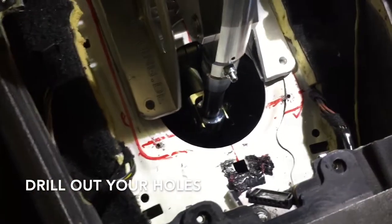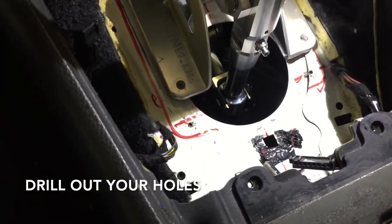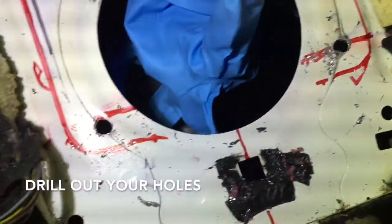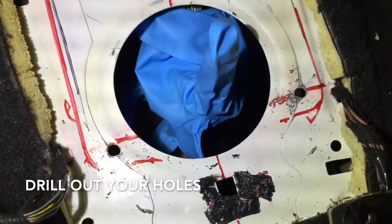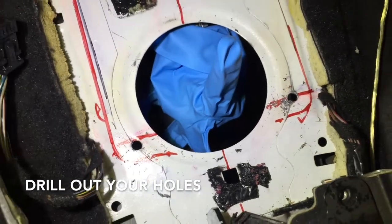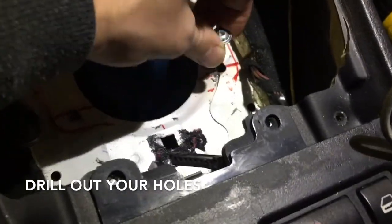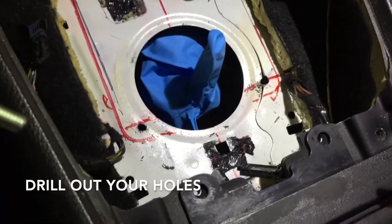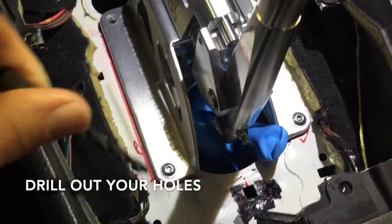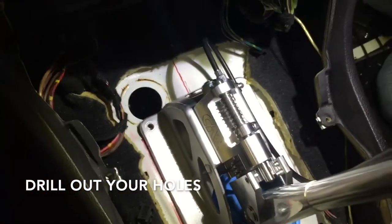With our first two holes marked, we're going to take this shifter out and finish the holes because we don't want to get metal shavings into our linkages. Because we're on the edge on both sides — which is also a good indicator that we're very centered — we're slowly increasing bit size so that we can keep consistency and not break any bits. We matched the supplied bolts from CAE and went slightly larger so we have some leeway. After oversizing just slightly, we mounted our shifter using the back two bolts and checked for center again — we're still perfectly centered.